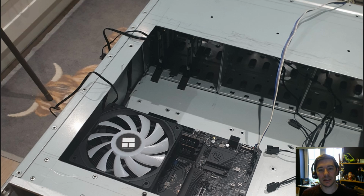So by flipping these hard drive cages around, so that I could access the hard drive from the front, had one massive benefit to this whole project and the case in itself, because the footprint was still very big. I wasn't that happy with it. What am I kidding? I was happy irrespective of this benefit that I discovered. But now, because I don't need to access anything through the inside, and I don't need that buffer to slide the hard drives out, I could slide the cage all the way in, almost butting up against the edge of the motherboard, and that gave me probably like that much space in the front of the case that was no longer being used.